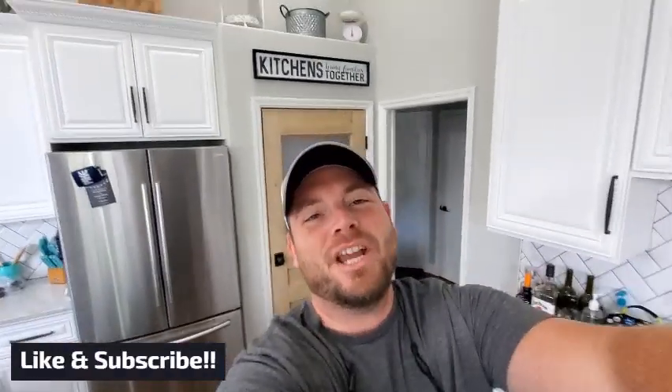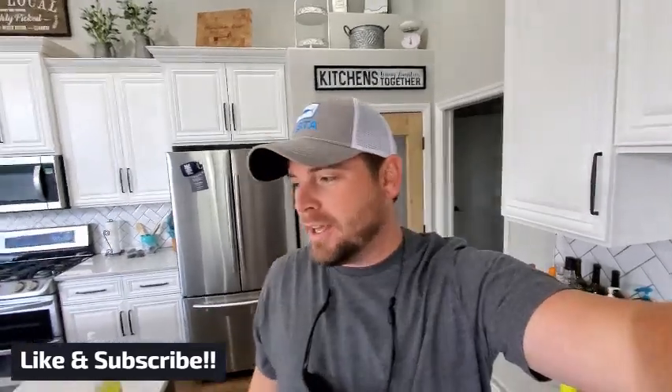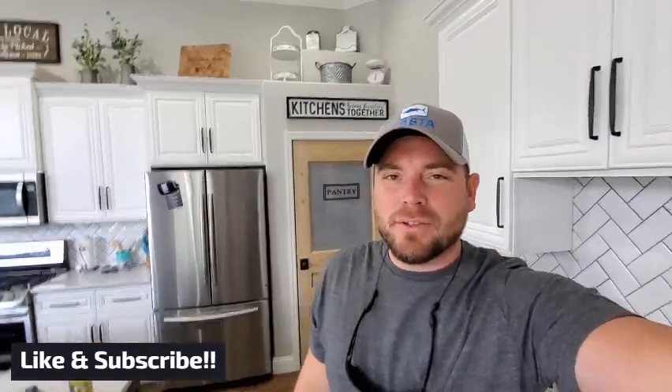What's up guys and welcome back to the channel. You probably saw in the thumbnail — we got new headlights for the truck. My truck is a 2013. The headlamps have been on there since original, and then two or three years ago I actually did the baking, cut the lens from the lamp itself, painted the housing black, and glued it all back together with silicone. It worked for a while, but some of the inside is starting to crack and my bulbs have burnt out like twice now in the last six months.